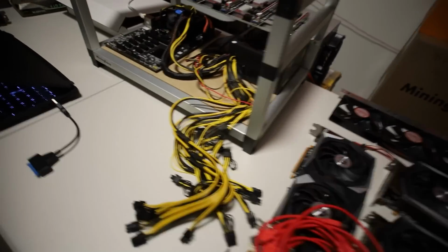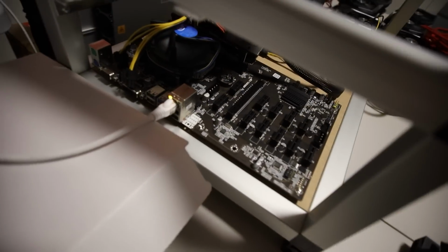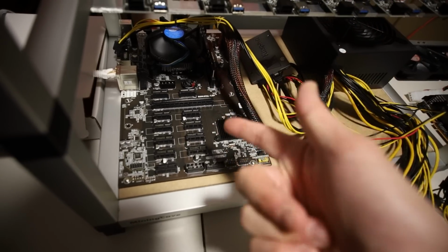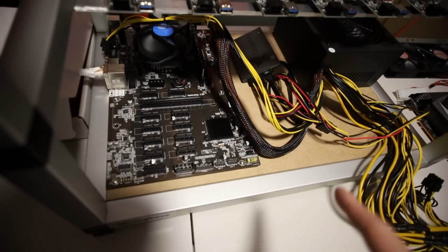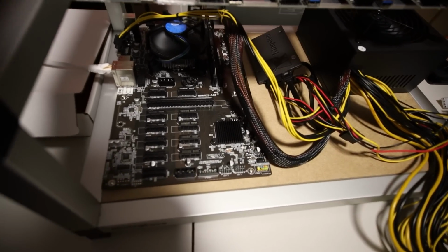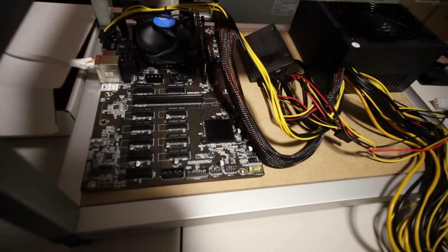And this Mining Cave motherboard actually already has the BIOS settings for AC power loss. So it's actually going to turn on already. And it has the 4G decoding BIOS setting and also the PCIe Gen 1 setting. There's also another BIOS setting called CSM. You may need to enable that and boot off legacy and disable UEFI. Just be mindful of those settings.